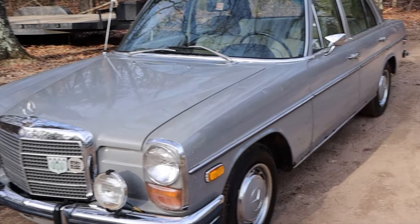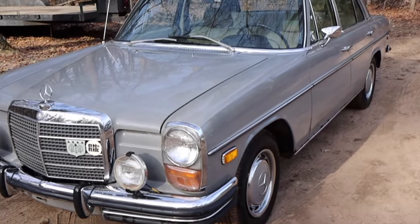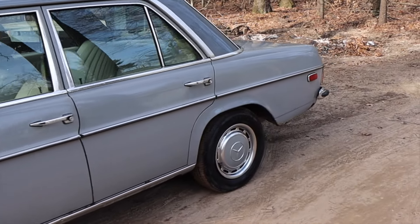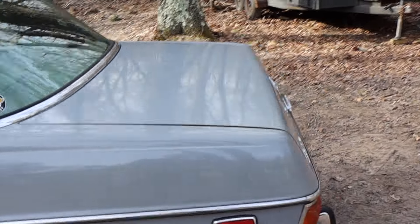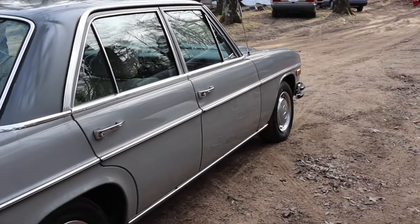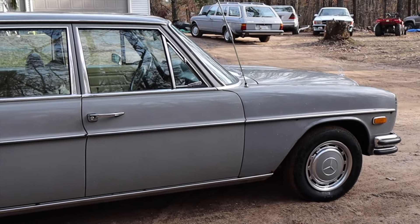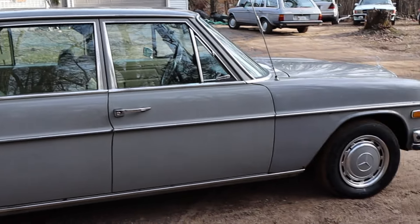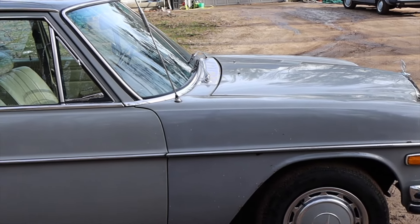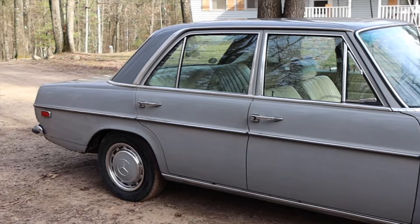Some things have transpired. Got the wiring figured out and I'm going to tidy that up. I was having a heck of a time getting it to run right — that O2 sensor — but now it just sits here and purrs. It idles perfectly. The fan stopped working, but we'll figure that out. Pretty happy with this. Kind of a random video of just trying to get this thing a new lease on life. I did the swap sometime last year but decided to go with just fuel-only Megasquirt fuel injection to get it just right, and it drives really good now. More on this car to come — probably a driving video and then buttoning up the wiring, cleaning it up, making it look good, and we'll enjoy it for the rest of the season.